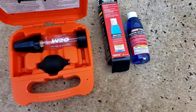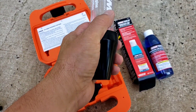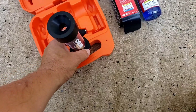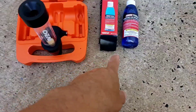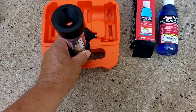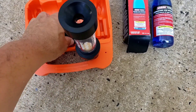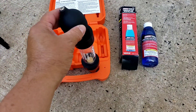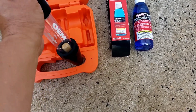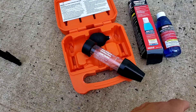When you open it up, that's basically what it is. You're going to empty your radiator to about three inches below the level. This here sits into your radiator like that — you hold it in there, take the little blue fluid, put it in here until it reaches the fluid level. Then there's a little pump over here to pump air into the system — a little squeezing bulb — you stick it in here and squeeze it, and it's going to suck out air through the bubbles through the fluid, which is blue.